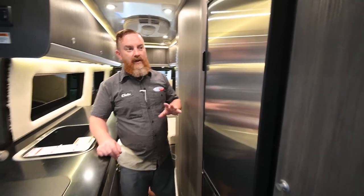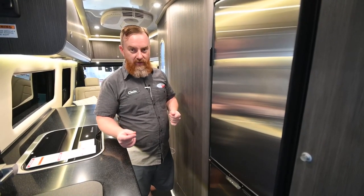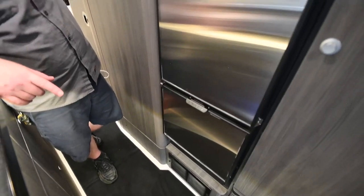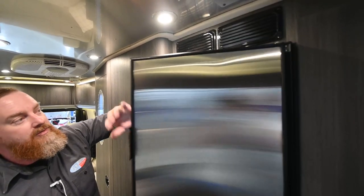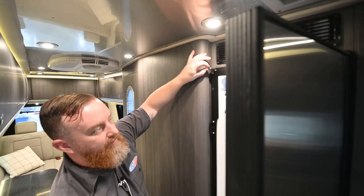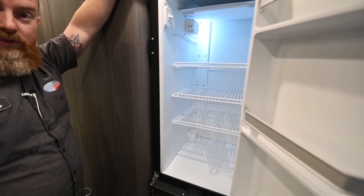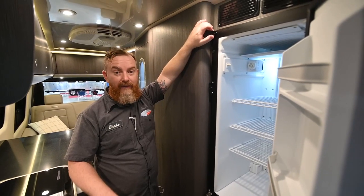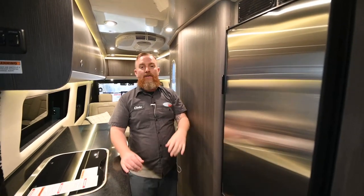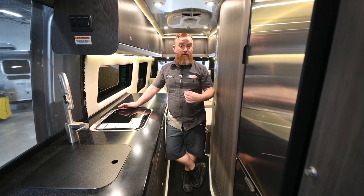This is an electric fridge — it's an AC-DC fridge, so if you're plugged into shore service, it's already running off of AC. Pull that plug and it's going to switch over to the batteries; you don't have to do anything to make that happen. These fridges have little travel tabs that help keep the door shut as you're towing, and you can use those when storing it to prop the door open. They take two to three hours to get completely cold — I recommend plugging it in and getting it cold overnight on AC power. If completely cold without an external power source, it will stay cold for five or six hours.